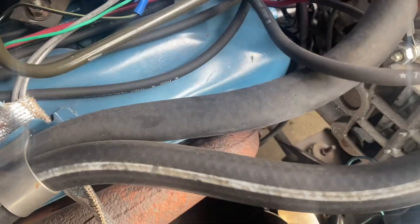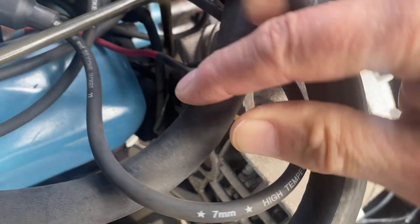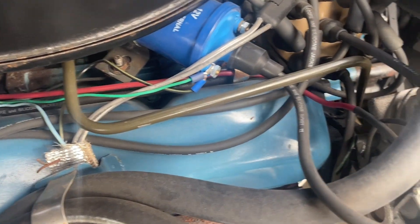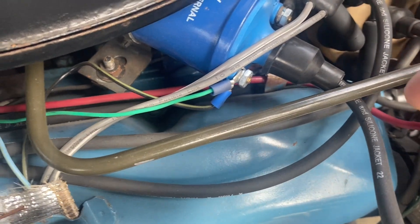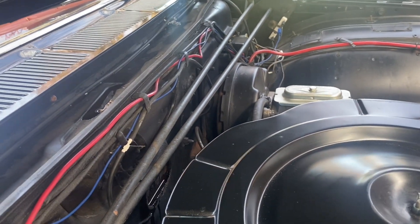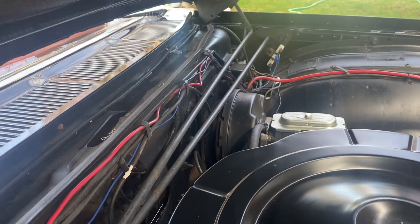Let's start over at the alternator. On the back of the alternator you can see the main wire, and I've added a second wire — it's a 10-gauge red wire. I paid about $10 or $11 for a 10-foot length of 10-gauge wire. It's pretty beefy and moderately expensive for what you get. This wire runs along the valve cover, snakes across to the other side with some other wires going that direction. That blue wire is from the ballast resistor going to my Rev 7500 electronic ignition.